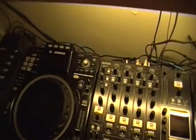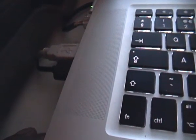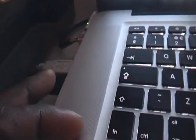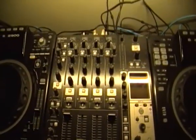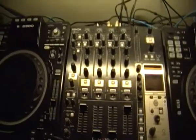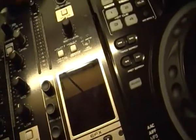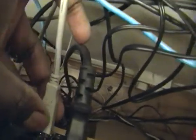In fact, I've just told you a slight bit of an error there. What I've actually got here — and this might affect some of you guys who have been complaining about distortion when you've got your audio going through Traktor — there's actually a difference in these two USB ports in terms of the bus inside of the computer, the channel as it were, that the data is going down. As far as you're concerned with this particular setup, the key component of the entire thing is the sound card that you're going to be using to drive your audio. As much as possible, you need to make sure that that sound card has direct access to the MacBook's USB audio components. So the way I've got around that — I make sure that this particular Denon USB cable is actually going directly into the USB section of the MacBook.